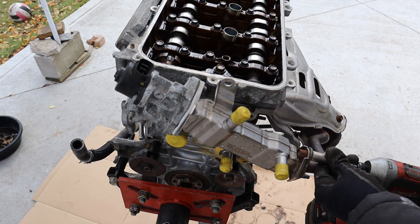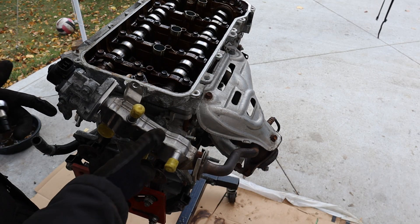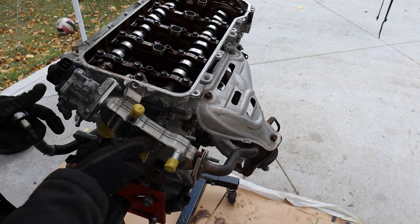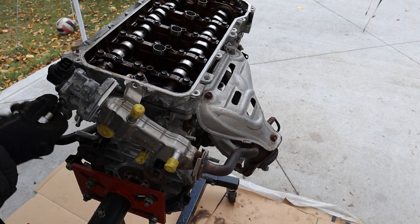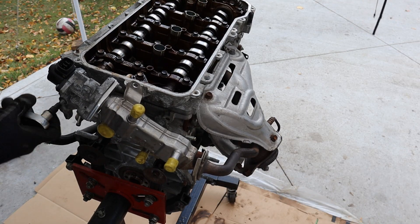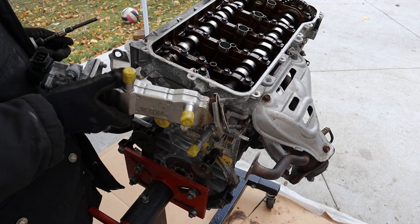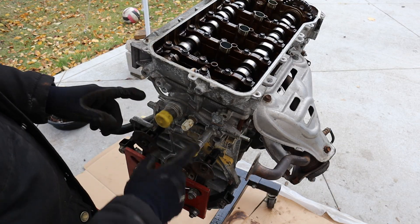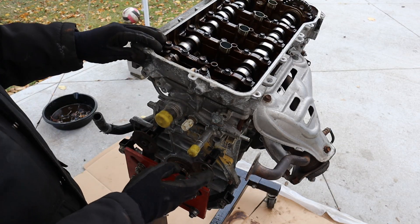I'm going to remove the 12s in the back here to get this EGR off. We've got studs going in this way and studs going in this way, so it's kind of a short circuit — I can't really get anything out so I'm just going to have to take the studs off. These are E-Torx E8 to get the studs out. There usually is a water manifold but it's actually built into the block, which I like because you don't have any extra gaskets or anything that would fail.